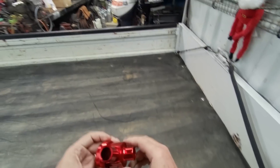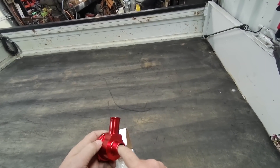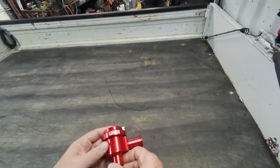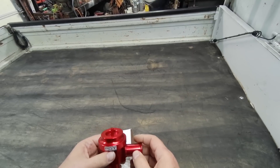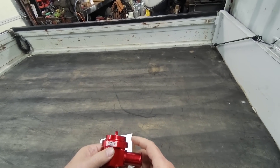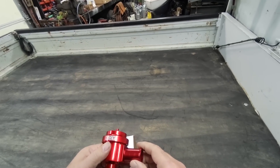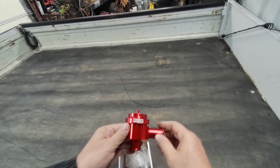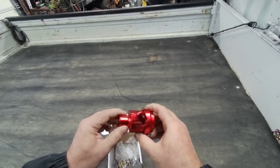I'm gonna see first off this bypass valve. At first I didn't think this would do anything because I thought it would just be boost push that off, which it does do to recirculate. But more importantly, a couple of you guys - Diesel Ram Charger I think was the first one to say it - that this vacuum will open that up on high vacuum on idle. Since I have a draw-through carburetor, then that will recirculate it.